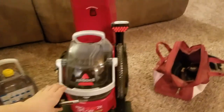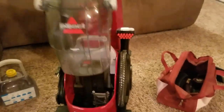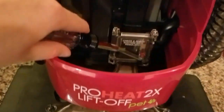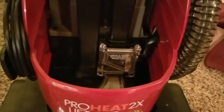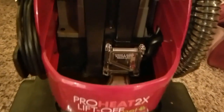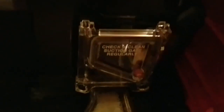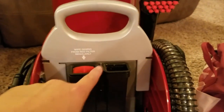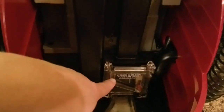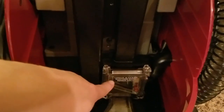The first thing you're going to want to do is remove the dirty water cartridge, and once you do that it opens up this area that says "check and clean suction gate regularly," but there's no clear-cut way to get to it. You can see there's an area there where the dirty water is coming from, so if there's a clog it's gonna happen around this area.